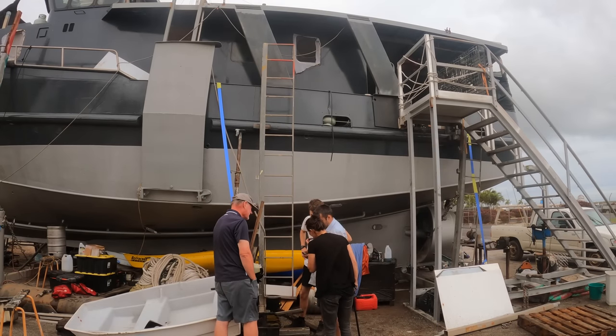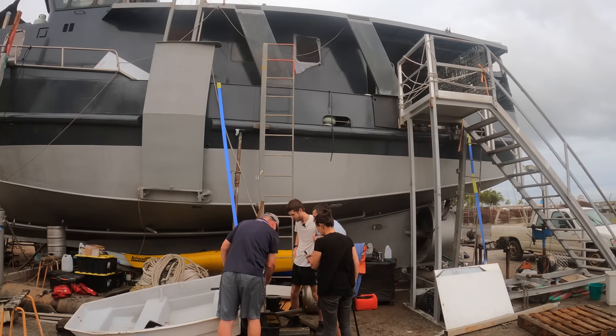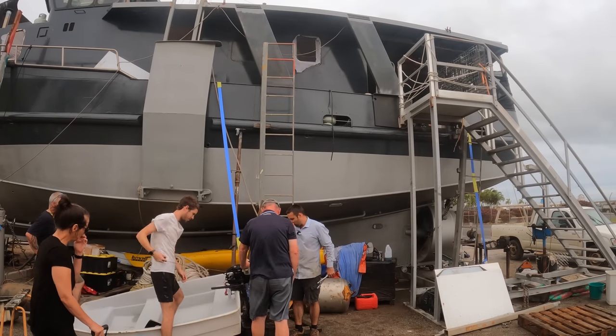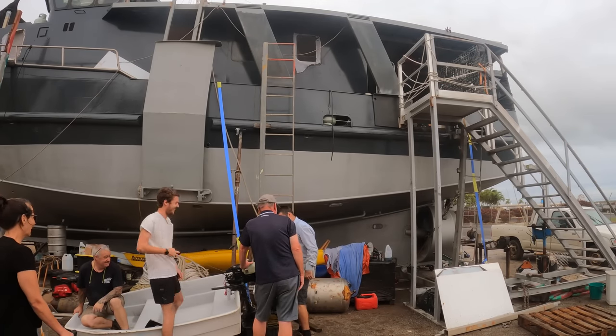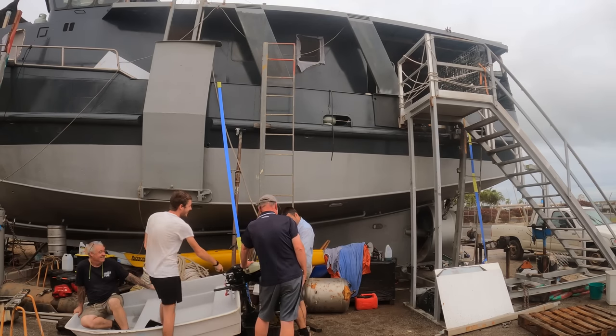It looks fine, but see how wet it is? Just flooded. So pull it over heaps now with the throttle on full and it'll clear the cylinder out. Just give it heaps, get rid of all the fuel out of it. Spark works. I'm not even going to touch it. I can feel it to about here.